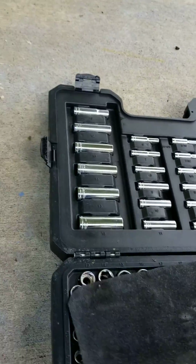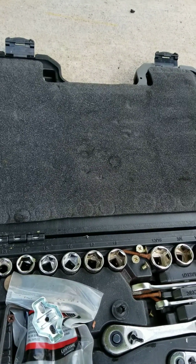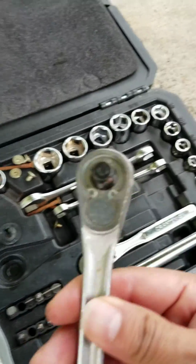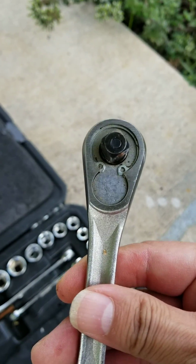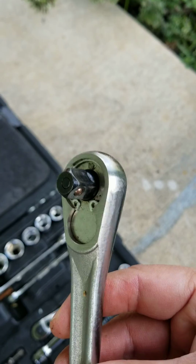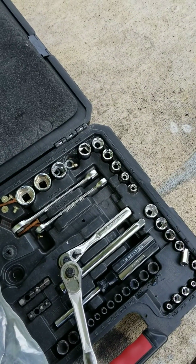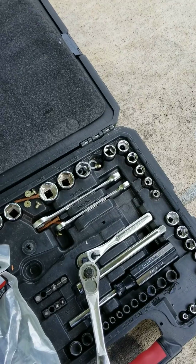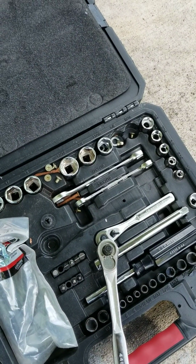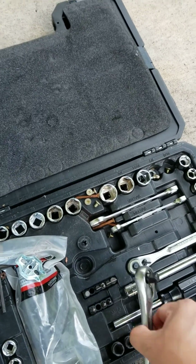If you don't have it, you could always get it somewhere else, like another auto parts store. But mainly, the biggest thing here is knowing what you got to do in terms of tools. So I got a nice little ratchet here that I'm going to be using. You don't want to use those air or electrical ratchets when you are taking the plug out of the oil pan. You don't want to ruin the thread. So be mindful when it comes to that, okay? It's very important. I believe that for this vehicle, you may be looking at a 5/8 or 9/16. I'm going to test those two out. I don't do this all the time, but depending on what size plug you have, you may want to utilize those two, because one of those two is probably going to be it.